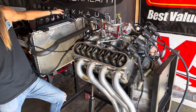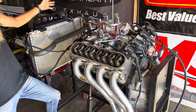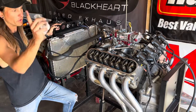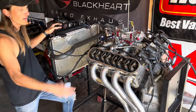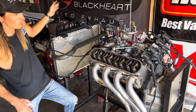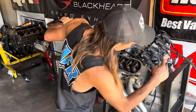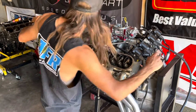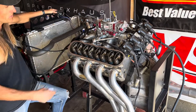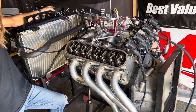I haven't made any changes to the run stand since I've used it. The next thing it really needs is more gauges and more wiring. I finished the wiring on the Firebird — that was the main project I was doing — and I was going to use a lot of that excess onto this. I want to get water temp, RPM, and oil pressure. So when I prime these motors up, I'm just going to fill it full of oil, spin it over, and as soon as we see oil pressure, we'll put plugs in it and fuel in it. Let's go ahead and crank it.